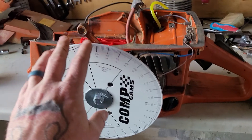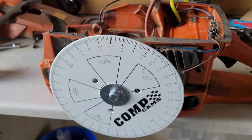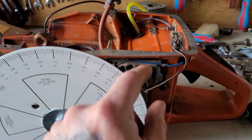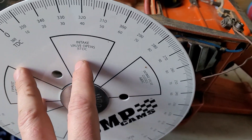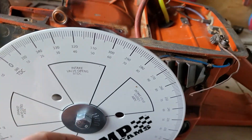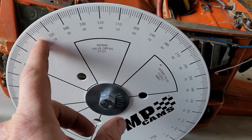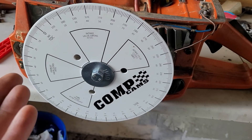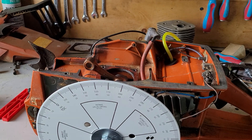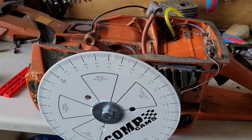This was what I came up with really quick — this is completely my design. But if you want to use it, you go right ahead. All I've done here is I've got some annealed wire and I'm going to use that as my pointer. Now, in order to get this thing set up properly, whenever I find top dead center, I'll have to loosen up this nut back here and turn this degree wheel in the direction that it needs to go so that I can easily put top dead center right there on my pointer. I hope you learned something from this video. Now I've got to go ahead and get some footage of seeing what the ports are like and everything, so we'll compare the two cylinders. See ya!